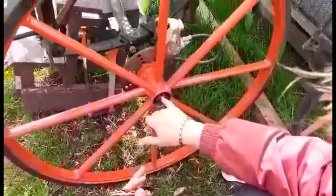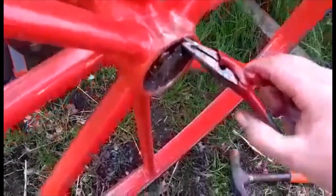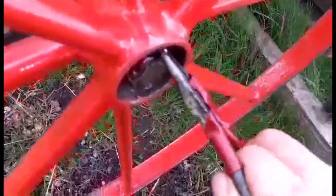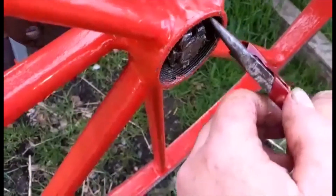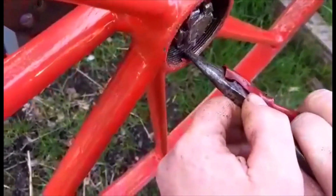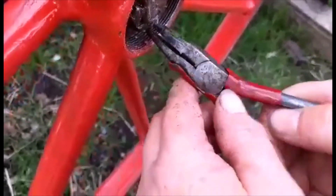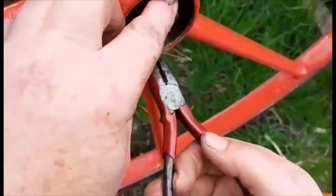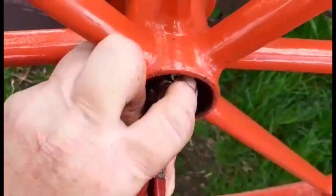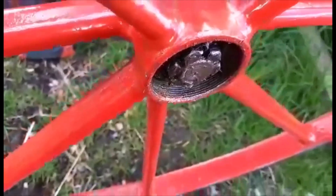This one's quite handy because it's just right at the top here. I've just bent my split pin slightly. There's a wee hole at the top and you just want to pop the split pin in. Straighten it back up after putting a wee twist on it so it goes all the way down. Then turn it round and one side bends up so it doesn't come out — and that stops the nut from coming off.